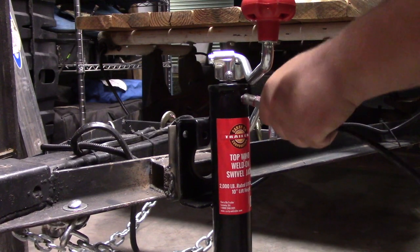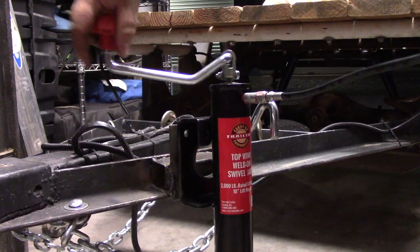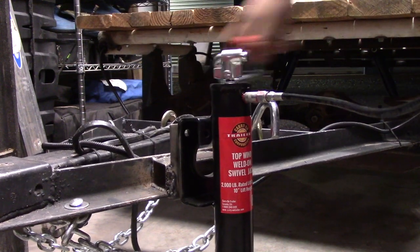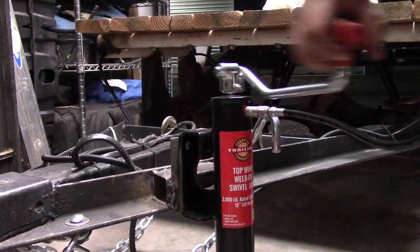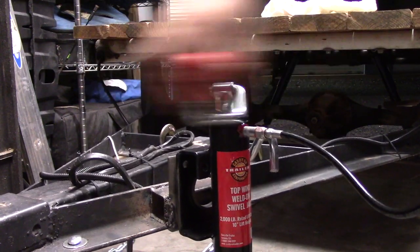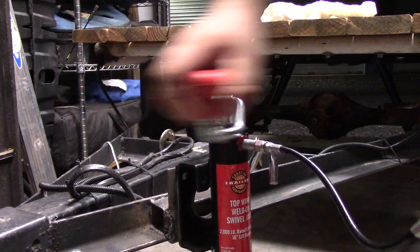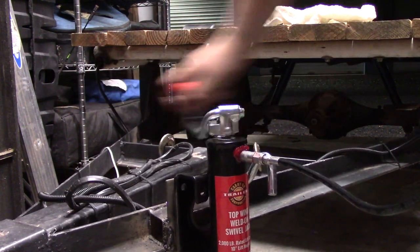So I found this clip when I was looking for me greasing the spindles on the Craftsman LT1000 I recently fixed and flipped, and I thought this would make a good little bonus number 6. A lot of your trailer jacks are going to have a little greaser to grease the Acme threads there. I believe they're Acme on most of them because they're pretty big threads. Just keep your trailer maintained, keep that jack working. Probably just throw grease in it maybe once a year, and you'd be good to go.